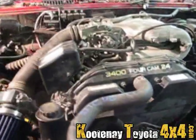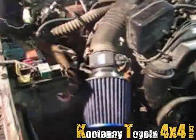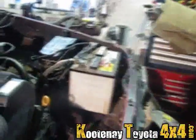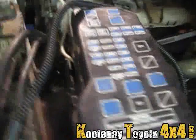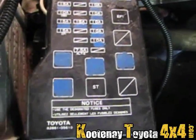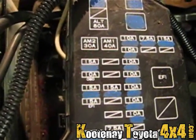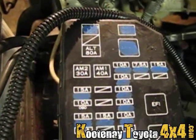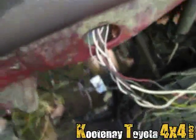Here she is — 3.4 liter in my '85 Toyota pickup, solid axle 4x4. I have the other harness in here, the 3.4 fuse box. I only needed basically four things out of the entire thing: the starter solenoid alternator fuse, EFI fuse, I'm not sure if I need the OBD fuse but I kept it, and then the alternator fuse, a couple of amps, and the EFI relay.